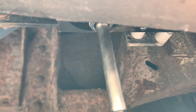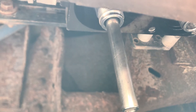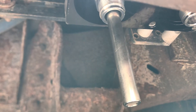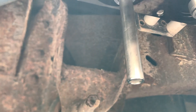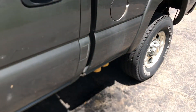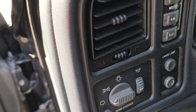We're going to screw those on right now. For the fuel filter, you're going to leave it cracked open and cycle the key to ignition until fuel starts coming out of the filter, then turn it off and screw your filter tight. After you prime that filter and tighten it back up when the fuel starts coming out, recycle the key again and you should be ready to fire it.